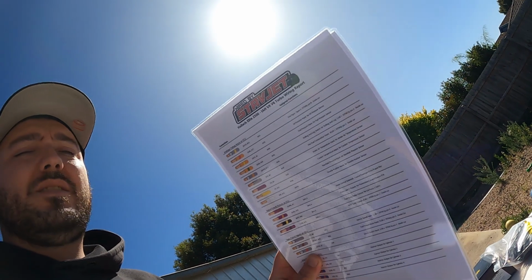Now, lots of customer interaction with this, because once this is done, I guess there's no going back. So it'll cost the customer money, it'll cost you time if you're doing it yourself, because you're then going to have to probably start splitting up the loom, saying that wire didn't go there, and changing it around, or repinning the ECU connectors. So I guess that's a bit of a rundown on the start of wiring up your car for an aftermarket ECU. So keep that in mind, guys.